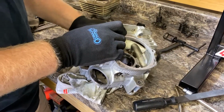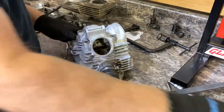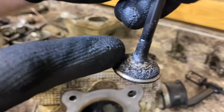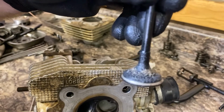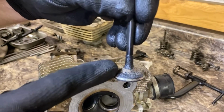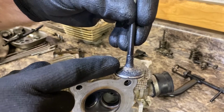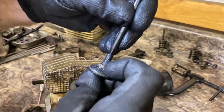Oh my goodness. That one's definitely got a burr in it. Let me pull this valve. Look at that buildup of carbon on there. She definitely was blowing oil, and we saw it was smoking, so that's a big contributor. Oil is leaking into the cylinder. It's coming up in combustion and it's just burning, and it's caked on the top.